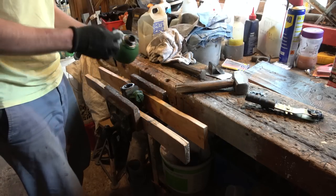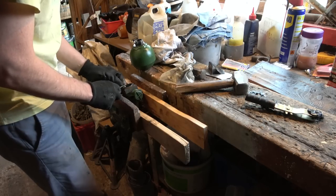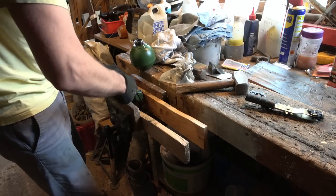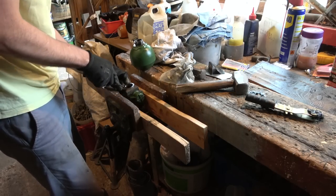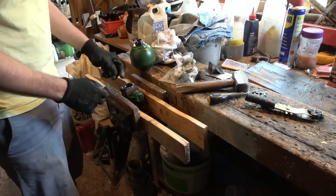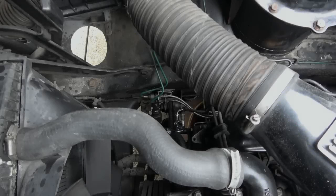Where's the rubber washer? The rubber washer is still here around the edge. Right, I'm going to give that a nice clean up and then try to take off the other one. This is going to be my plan down here - it's very hard to get to underneath. It would be a lot easier if you had a pit. I've got to jack the car up to try and get under it and it still looks like it's going to be tight. Rather than trying to get the chain in there - I can't because that side of the sphere is against the engine block with about this much room - I'm going to use the Dremel tool to cut a notch, then go in with a very long chisel and a club hammer.